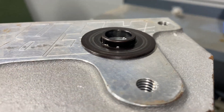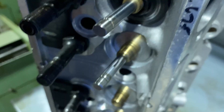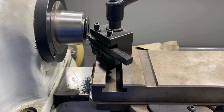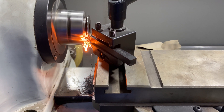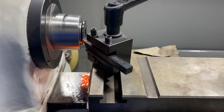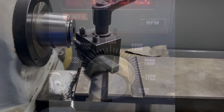These spring seats I have for my heads don't exactly fit, so I have to machine them today. They don't sit down properly, so I just need to take 10 thousandths off — like this one — and they'll be ready to rip. A little bit of hardened steel, machining spring seats today. Last one going in for the cut.